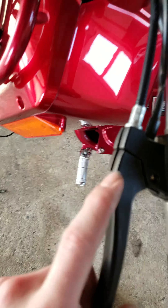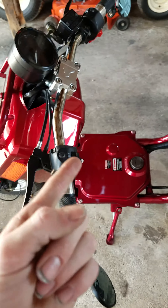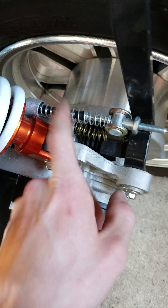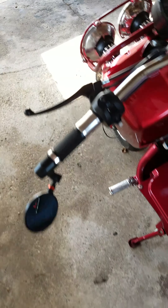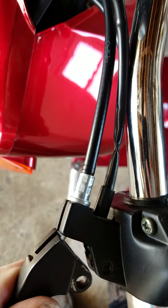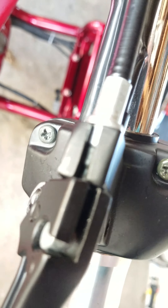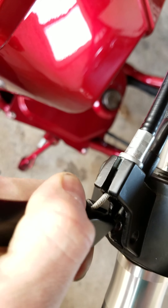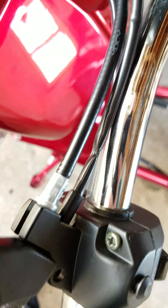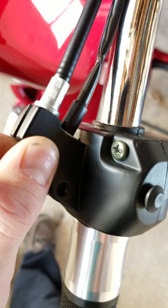This is gonna be the tricky part with the cable-guided one. You could do it one of two ways: the easy way is to just disconnect the back brake line so there's no tension — basically screw that nut all the way out and it'll relieve the tension. Or you could do it like me and not do any extra steps — pull it back a little bit, watch that groove line, shift it, and there's actually a ball. The whole object is to get that ball and cable out of there, so you grab the lever, shift up on it while pulling it out, shift it up a little bit, and bam — got it out.